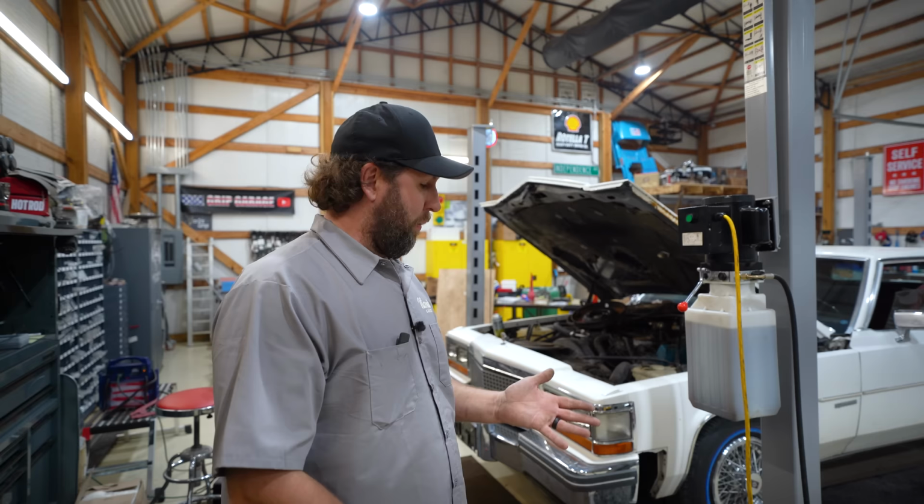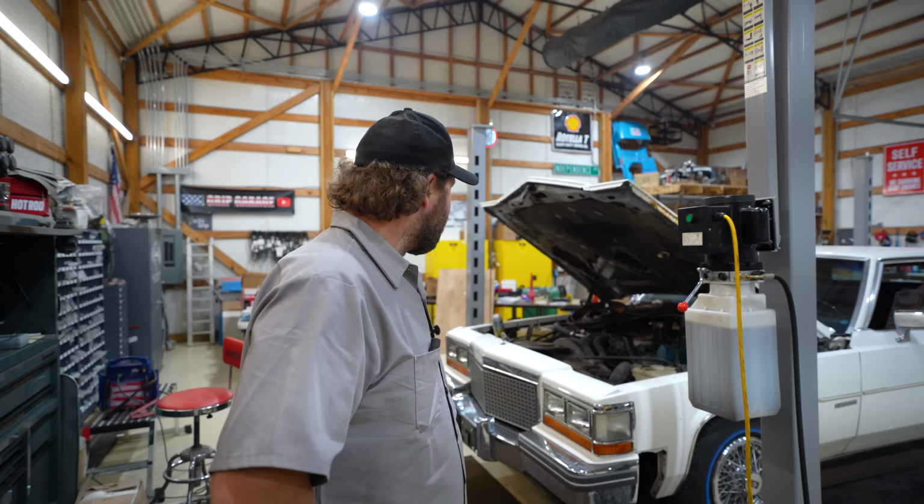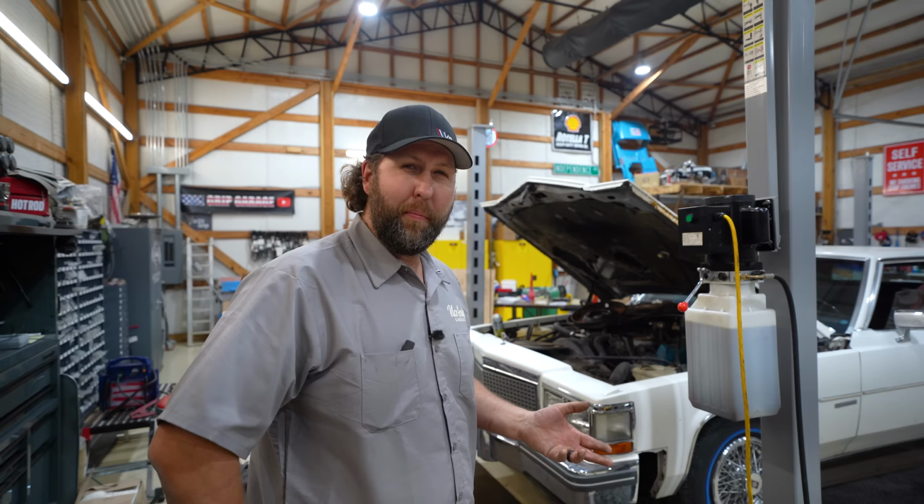The power windows never worked. They're starting to work. The power seats never worked. The motors are running, but the seat's not moving, which means the GM plastic gear explosion has happened. Power locks haven't come around yet. We got lots of lights. Maybe I'm getting re-excited about stuff I was excited about before, but this is a 62,000 mile car, and that just tickles my bottom left foot.